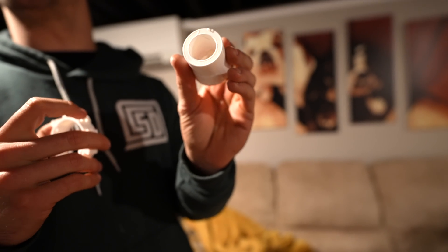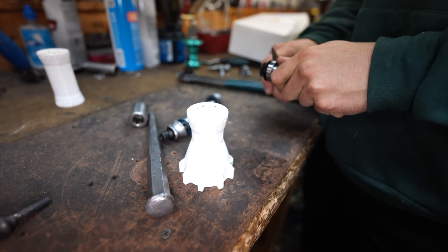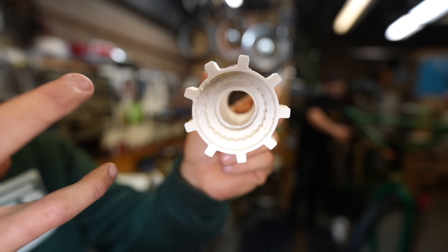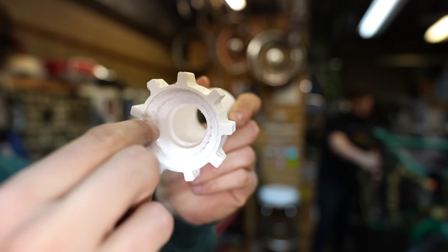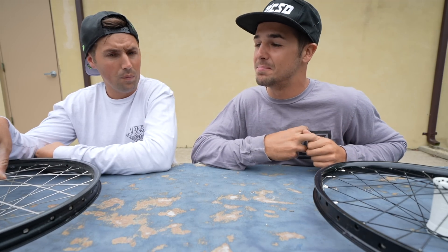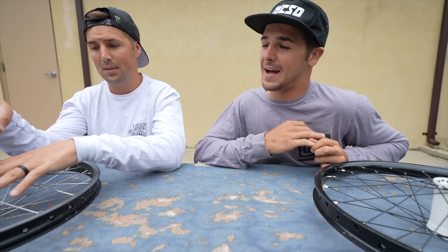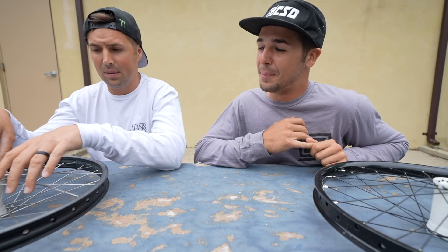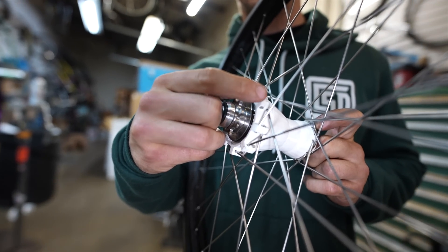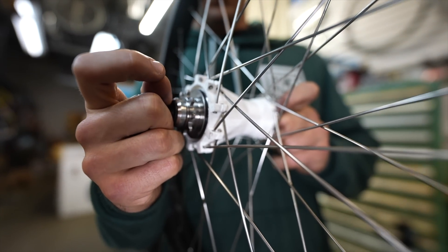These hubs are built of more or less hundreds of different shapes. The rear hub includes flanges, bearing seats, and the driver teeth where the hub engages — all built on TinkerCAD, which is pretty insane. Maddie built the driver teeth in plastic using a Profile mini driver as the reference, knowing the plastic wasn't meant to last forever under that kind of metal-on-plastic stress, but it worked perfectly on the first pedal.